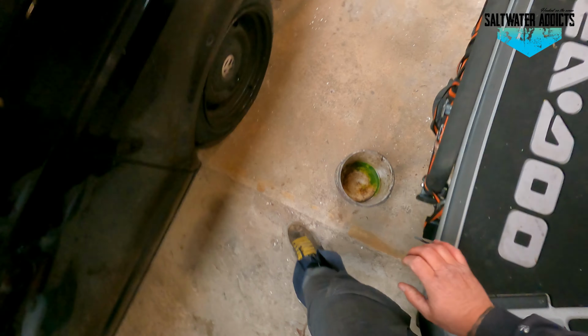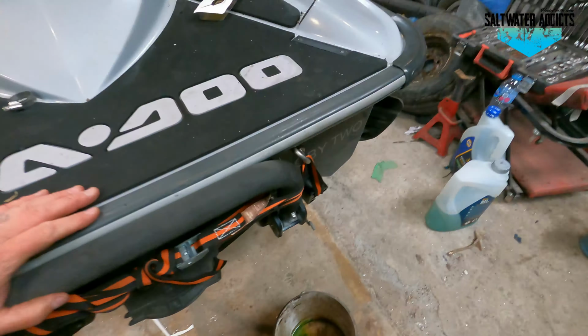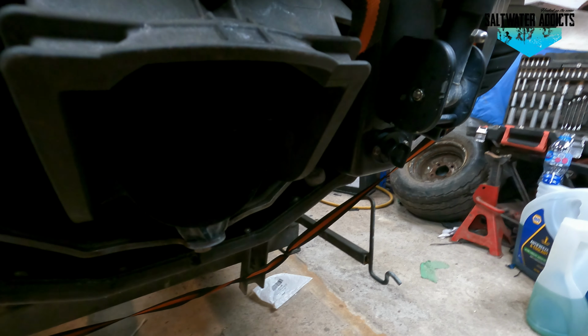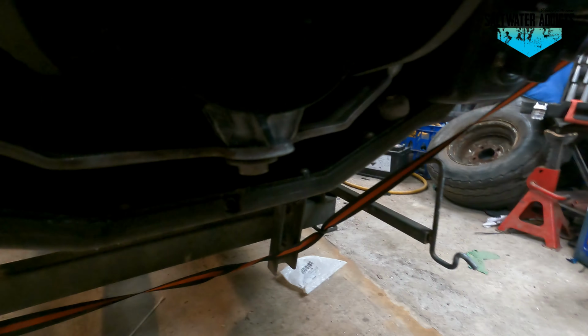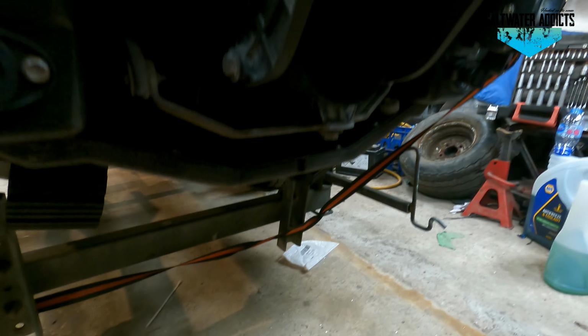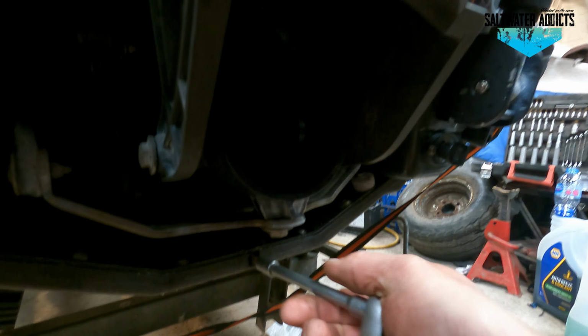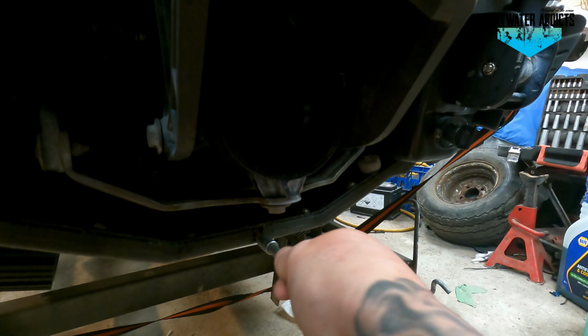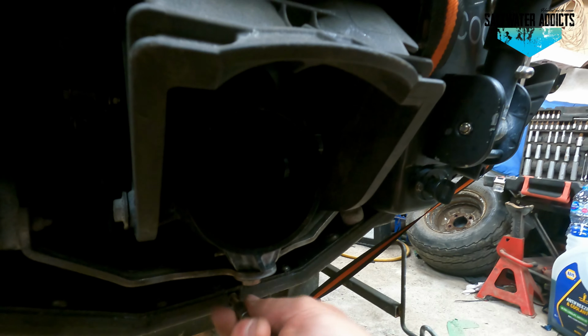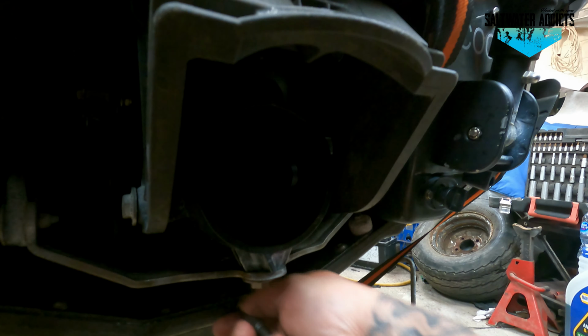Right, now, next bit. It has got coolant already in it, down here, and your coolant is in here. This is what you're going to do. And that takes, I believe, an M5 to get that out there. Little Allen key style thing. Right, so that's what we're going to do now. Doesn't take a lot. There we go. And this is going to come gushing out.